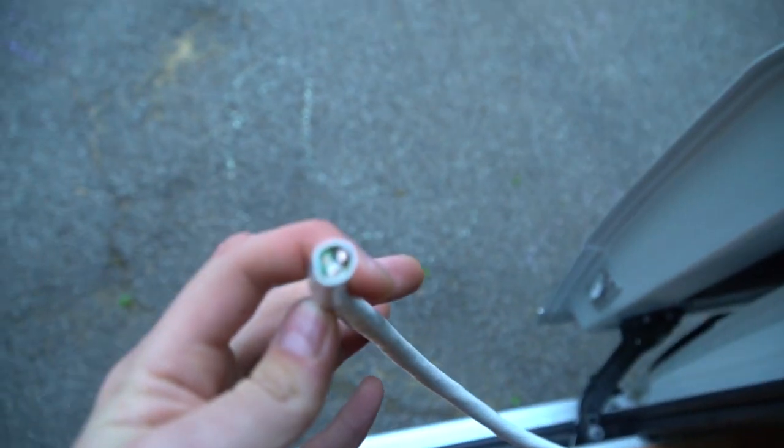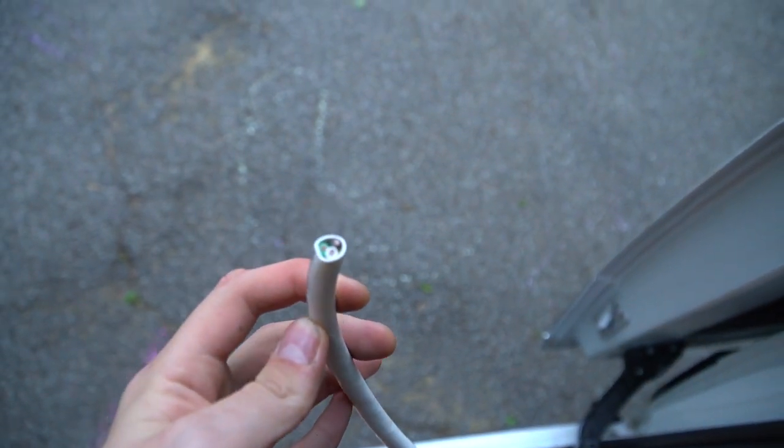Unfortunately, I didn't have enough cable to finish, so it's not my fault that I didn't finish, but I definitely would have. The 12 gauge wire for the 120 volt circuits is so much easier to run because all 3 wires are encased in 1 white cable strand, and it's very secure, so I don't feel like it needs conduit. But unfortunately, I ran too short and I still need to run across the van for 1 more outlet. So for now, it'll have to do. But I think we can still move on with the build, and I should get the wires Monday. I already ordered it on Amazon. So should be good, but moving forward for now.